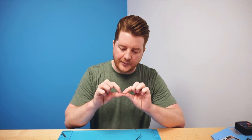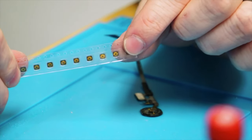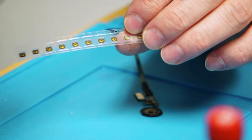This is actually a really easy thing to do. You don't want to just rip off the little black dot — you want to actually take off the Kapton tape square. When you look at these you'll notice that they are gold, and they're only gold because of Kapton tape. Kapton tape is like a copper-colored tape, and on top of that tape there is a little black nub that touches the back of the bracket and makes it click.